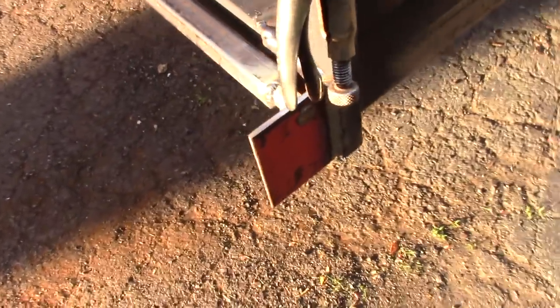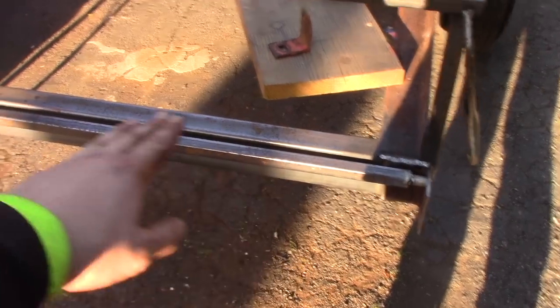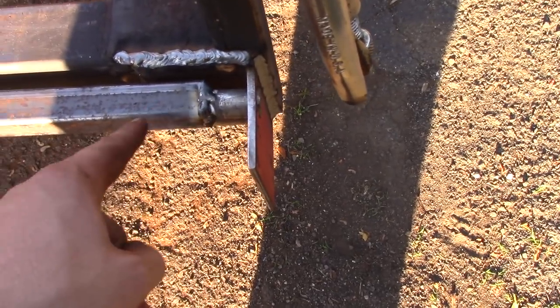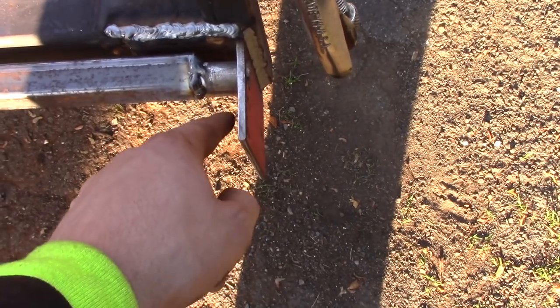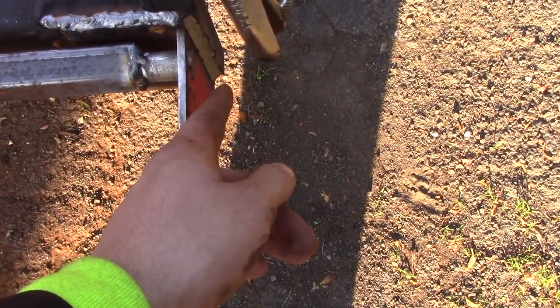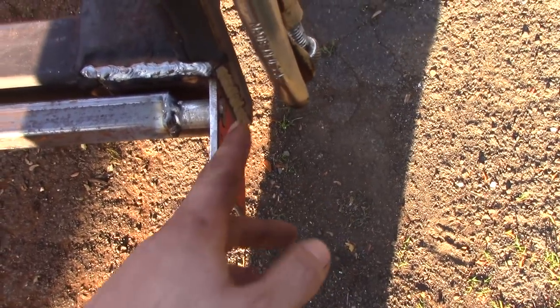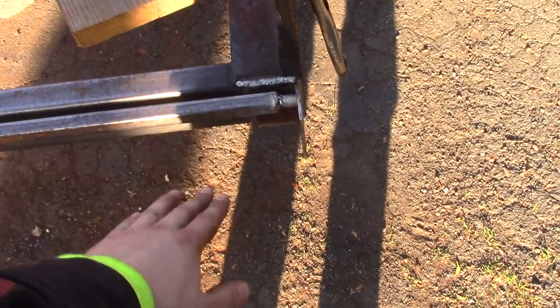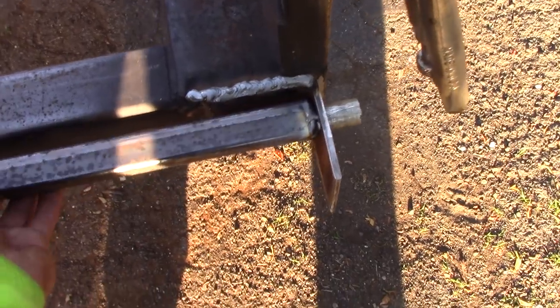This is how far I've come on the tailgate. I've gotten that angle welded up, got the holes drilled, and have everything laid out so that piece that's going to hinge is perfectly flat with my rear crossmember. This is one-inch square tube - I welded bar inside there. I'm going to drill a hole through this bar, put a washer and a cotter pin at the end. What that allows is if I want to take the tailgate off, I remove the cotter pin here, cotter pin there, slide this out, and this end will actually pop right out. I've got to work on the tolerances a little bit but I think you get the idea.